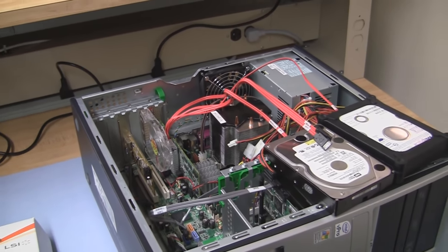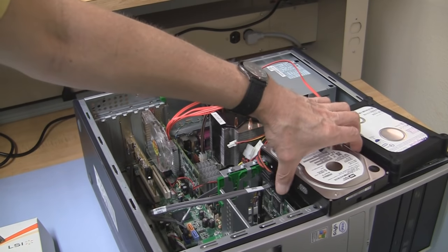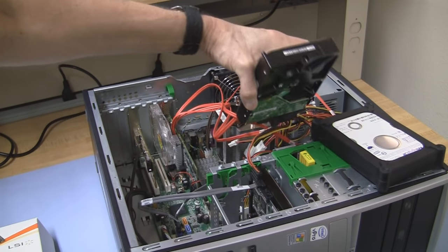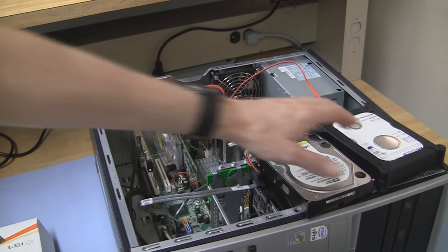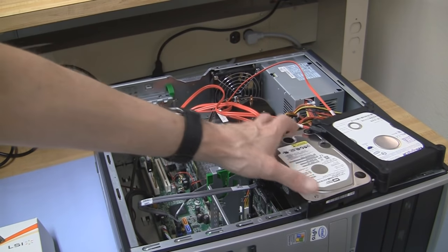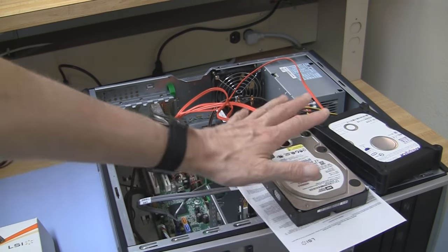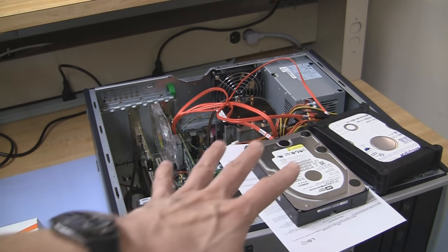You want to be very, very careful about your hard drives and where you put them. You want to make sure that you do not expose the bottom of the hard drive to metal. We never put hard drives sitting on anything except something that would protect them. We want to make sure that all your drives have a rubber enclosure, or we set those hard drives on some kind of insulator. Never set hard drives with their circuit board sitting down on metal — that's a disaster.